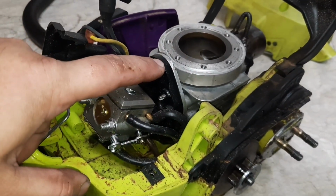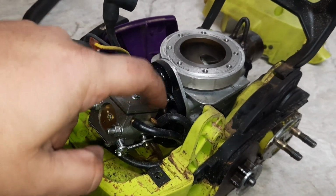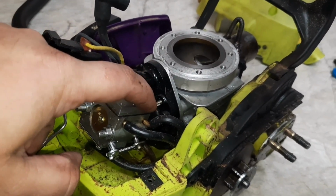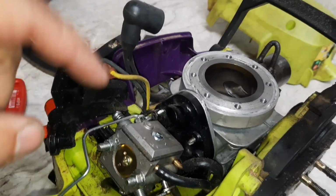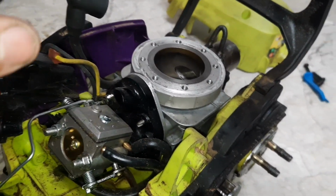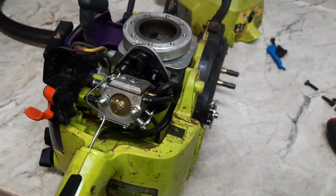I ran out of JB Weld to blend this piece into the cylinder, so I have a gnarly step way out at the cylinder flange. So that's not helping. It'd be nice to get that taken care of. Adjust the porting some, adjust the pipe some, and I think we might be able to do it.